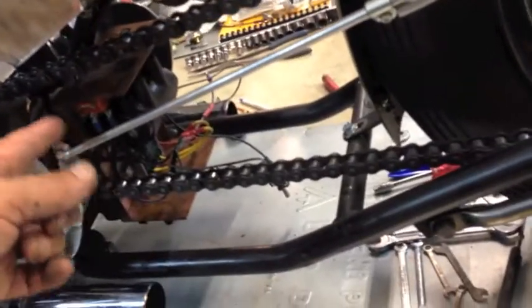Alright? So it's tail light. And the green is your brake light, and the black is your tail light. Okay, so that's why the black goes down and is wired to the switch. When you turn the switch on, it turns on the headlight and the tail light. Okay, you don't need a tail light in the daytime unless you're in a state that says your headlights and tail light have to be on. Only thing you need is a brake light. So that's why you have two wires.